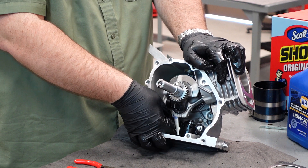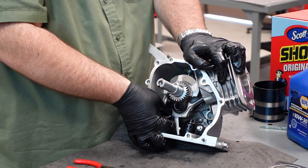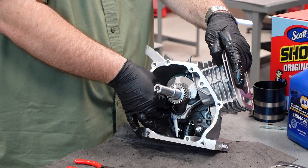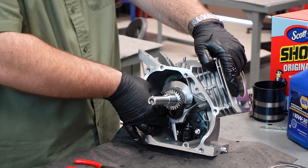Your goal is to make sure you have plenty of oil in it. Oil not only lubricates, it cools — it's your only form of cooling other than air circulation across these engines. Always make sure all your dust guards are in place so that the flywheel fan can do its job.